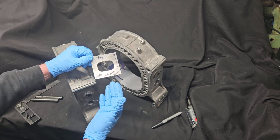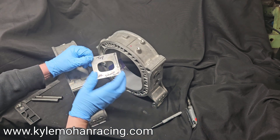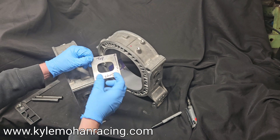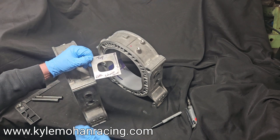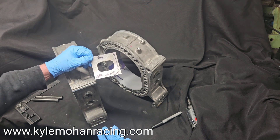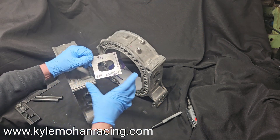We want to keep velocity up. We want exhaust flow to work well. So we like to have a slightly rounded square design that does squeeze the air at the top. As the apex seal comes up, it's a nice abrupt opening, dumping exhaust volume, getting that exhaust charge moving, and then starts to squeeze it — not too abruptly, not shutting it off too quickly, but squeezes a little bit to keep that exhaust flow up. Really good for street, race, and performance use. If you get into the absolute extreme ends where longevity and reliability are less important, then you can square it up a little bit. But if you're starting with this template, that's up to you to adjust it. This is a nice reliable and very adjustable design that's centered off the sides.